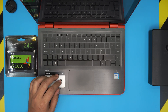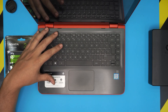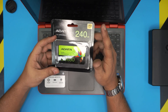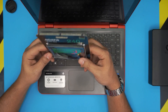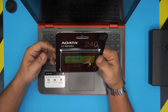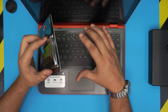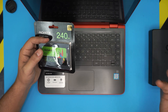In this video I'm going to show you how to remove the mechanical hard drive and replace it with a solid state drive. You can purchase a good brand SSD like Samsung, or go with a cheaper brand — the client brought in an A-Data 240GB today, but these are really low quality grade SSDs. They are still faster than a mechanical drive, but I suggest going with Samsung or Crucial. I'll also show you how to replace it with a higher capacity mechanical drive if you prefer.